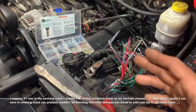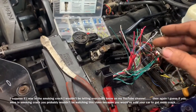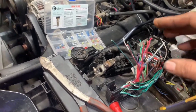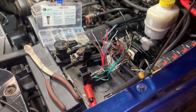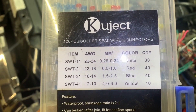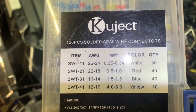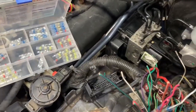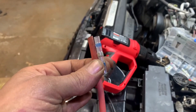I have a couple steps and procedures that I use when connecting a boatload of wires like this situation. First off, I put my heat shrink on. Even though I'm working with somewhere between a 16 to 20 gauge wire, I actually use the blue ones designed for 16 to 14 gauge, instead of the exact wire size range of 18 to 22. The reason I do that is because once you go to put these wires together, it becomes a little bit difficult to use the exact same gauge if you have the longer style heat shrink.